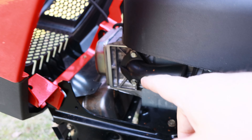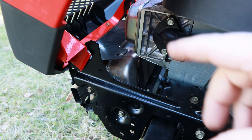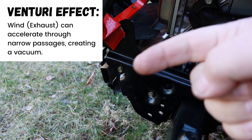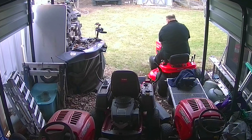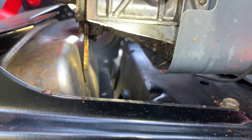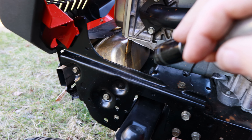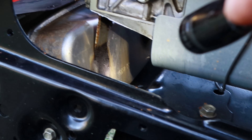What I'm trying to identify is when you've got smoke coming out back here — it doesn't smoke necessarily when you first start it. But then after the exhaust system starts to warm up, it'll start smoking and it may appear to come out of there because that creates kind of a venturi effect and it'll suck the smoke out with the exhaust. You'll notice when I first start it, you will not see any smoke come out of the exhaust. So you can see how that started smoking back in there after it ran for a little while, and it does appear that it's coming down and coming out of the exhaust, but it's actually coming from behind here.